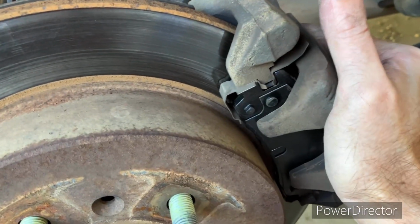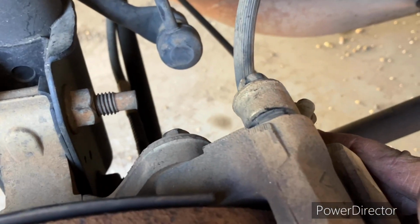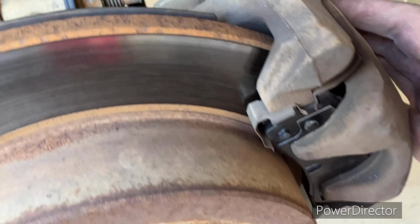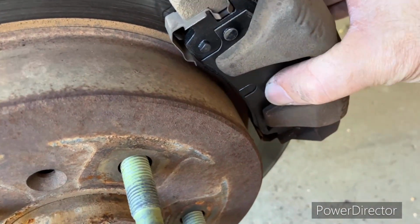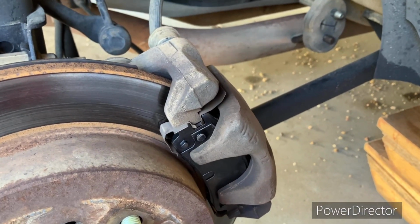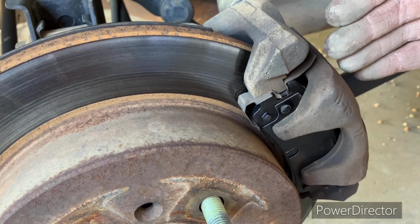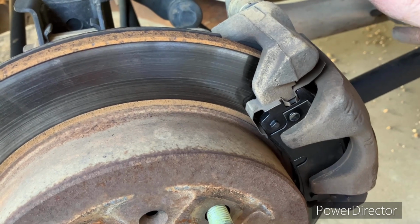See how this moves? This is perfectly normal. See it squeeze back, slides back and forth. This is perfectly normal because that plunger has it pushed on the back of that brake pad, unless you go get in the car and press on the brakes to get that plunger to push against the brakes. Okay, so there's a little bit of gap in there right now, which is fine.